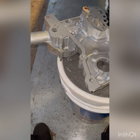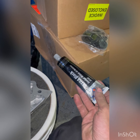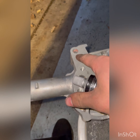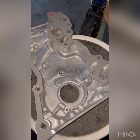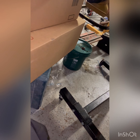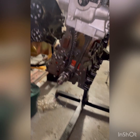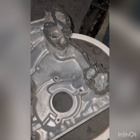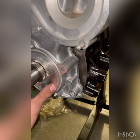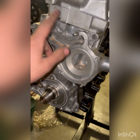Another thing I like to do is get some silicone - the black one is the best kind, it works for everything, not just oil even though it says it's for oil - and just put it around the bolt holes to make sure everything's sealed up really good. I'll put some all the way down and around everything just to make sure it seals perfectly and I don't have any leaks, because I'm tired of this motor leaking. Now I've got silicone all around all the bolt holes and all around where the gasket goes. Now I can throw it on the engine - here's the timing cover on. I have to put all the rest of the bolts in but I've got the top one in, so I'm going to start tightening the rest of this thing down.